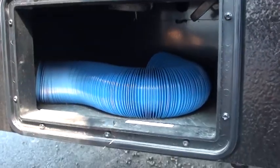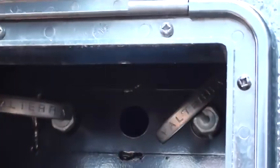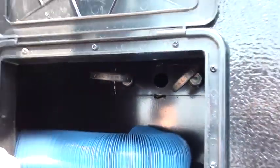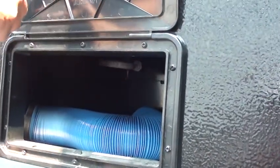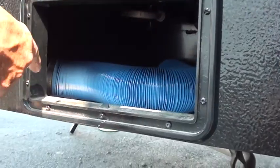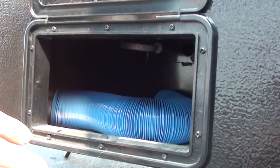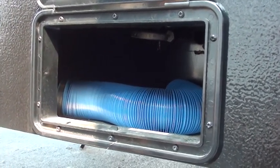There's your sewer hose. There's your black tank valve — it's just push-pull. Gray tank is all your other water like sink and shower. Pull your black first, then use that hose attachment to flush it out, shut it, and then pull your gray. If you forget something I've said, please call us — we'll help you.